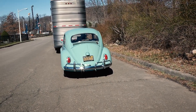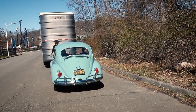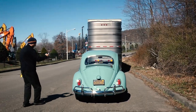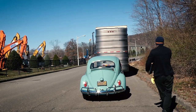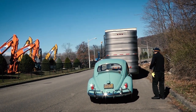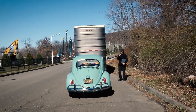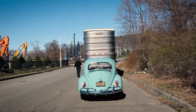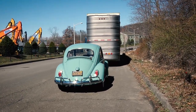What my father was saying is: sometimes on these trucks, if you're having a car shipped, it's good to let the next owner know to double-check the oil. Just take the dipstick out and take a look. If the oil level is way up, there's a good chance the car was nose-up for a long period of time. What happens is the gasoline goes into the crankcase past the needle and seat on the carburetor — now you have gas in the oil, and you do not want to start the car at that point. Always double-check the dipstick when the car arrives. This car should be level from what the trucker said, so Lori's should be good to go.